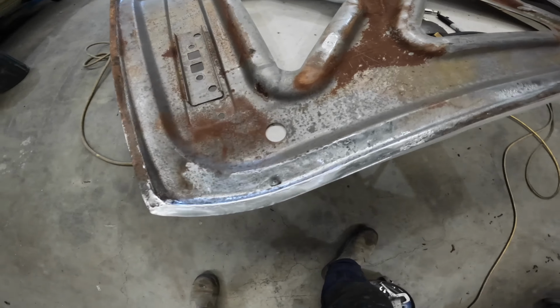nice and clean on the inside now. We'll cut it out, weld it up. Nice clean steel. From here we still do trial fits of the skin to make sure the frames are repaired properly. Once it's all cleaned up, coat of epoxy, prime inside the frame and inside the boot lid skin as well.